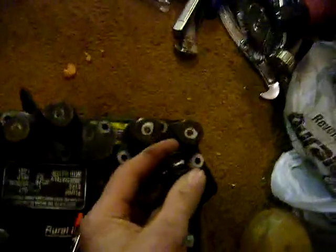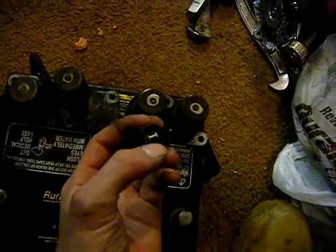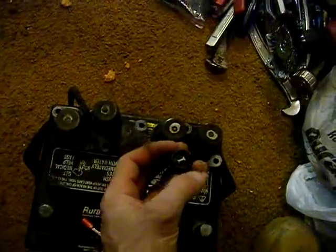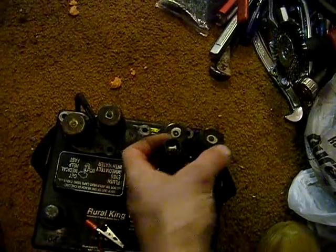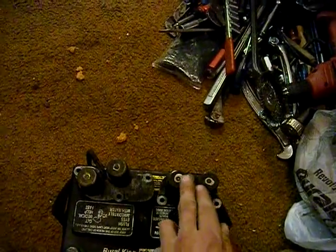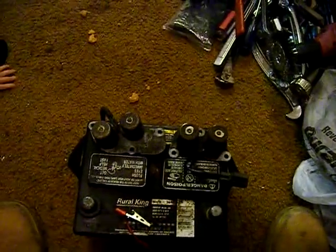In each one of these connectors there's one wire on one side and one wire on the other side. You just take the gator clip and clip on one or the other, depending on which solenoid you want to test. One wire goes to one solenoid and the other goes to the other — there are two solenoids per cluster, and there are two clusters.